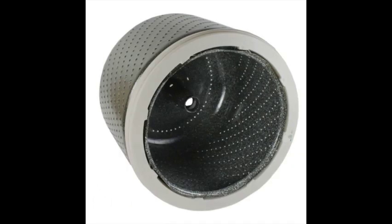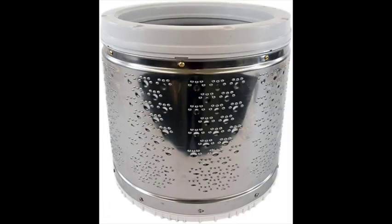Let's compare these two washers from a service technician's point of view. The Amana has a three and a half cubic feet porcelain-covered steel spin tub, as compared to the GE's 4.2 cubic feet thin-gauge stainless steel and plastic tub. Just because the GE has that larger tub, I don't recommend overloading the machine. Unfortunately, they didn't oversize the suspension systems, and many people ruin their washers by stuffing a king-size comforter in just because it fits in that tub.